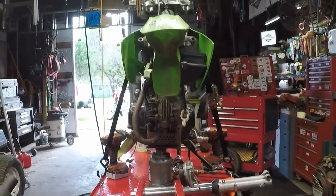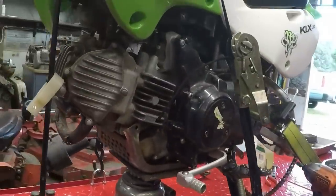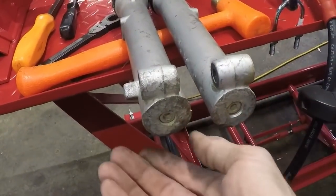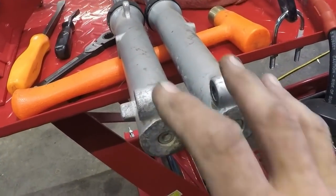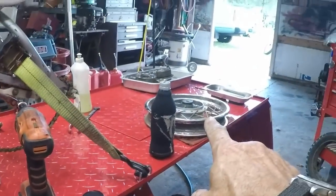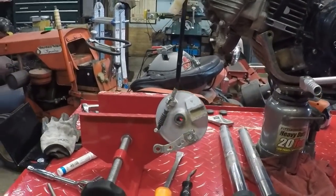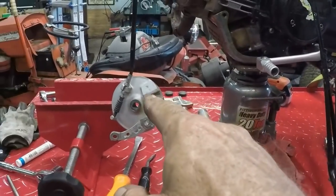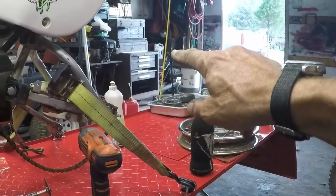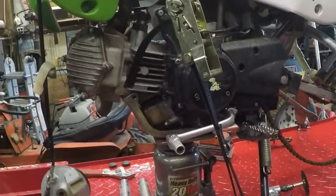This is going to round it out for part 2 of the Kawasaki KLX 110. We've got our work cut out for us. Part 3, we'll tear the shocks apart. I'm going to order spokes and order brake shoes. The brake shoes on the front need replaced. The ones on the back are okay. Our dampeners are okay on that. They can live for a little while longer.